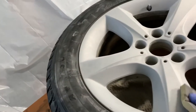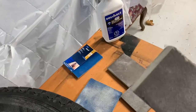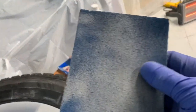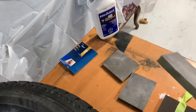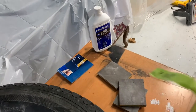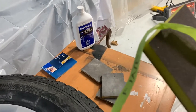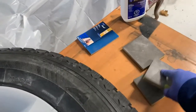These rims weren't the easiest to sand. I used various pads. I tried this block — it's flexible but didn't really do a good job, so I don't recommend it. I also found one at the local hardware store, but it gets dirty pretty fast, so don't waste your time with it. The best results I had were with these pads from the local paint store. I used a medium grit first — somewhere around 120 to 140 — and then switched to fine grit, around 160 to 180.